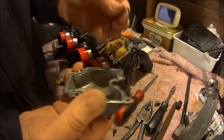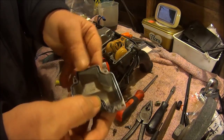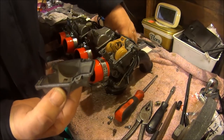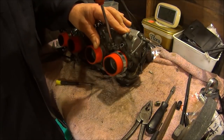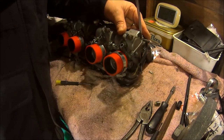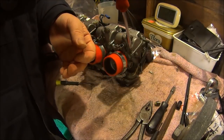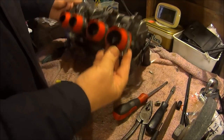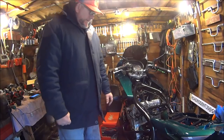Let's put the last bowl on. So this carburetor's had a new gasket and a new needle valve and seat. I just hope it's not this air fuel mixture screw. If it's to do with that, I am shot. We just whack these screws down and just double check they're pinched up. You drop the screwdriver because you're trying to hold it so lightly so you don't over tighten them. That's my excuse. And there we go. Now hopefully we can stick them back on the bike and everything's okay and the bike will run perfect,